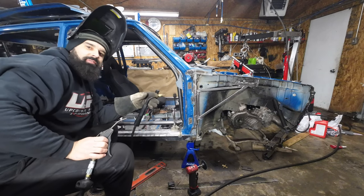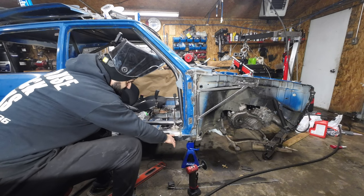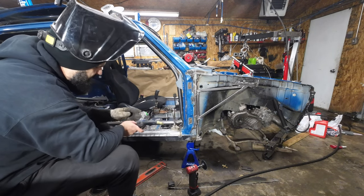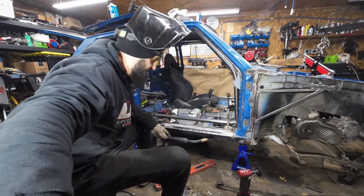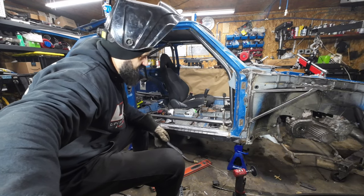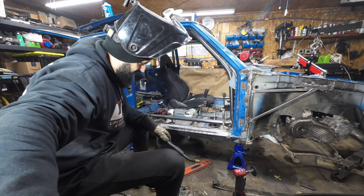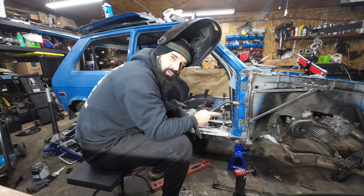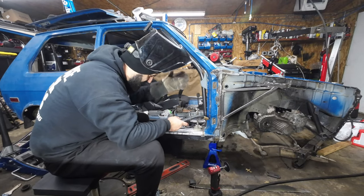After a while I like to cool it down so the metal doesn't shrink or warp. So far it's looking good. I'm gonna wait on the spot welds last just because I don't have the right pliers — I lost mine. Make sure you leave a little gap so your welds can actually go between the two metals.